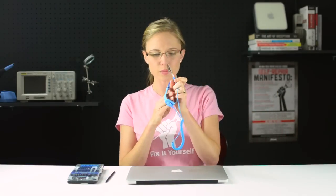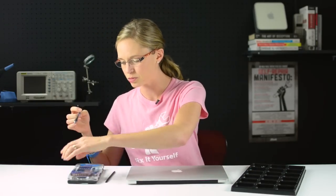I'm also going to use an anti-static wrist strap to protect my MacBook Air from any accidental electrostatic discharge during my repair, and a screw tray, because it keeps all those teeny tiny screws nice and organized. Now that I've got all of my parts and tools together, I can get started by taking out the 10 Pentalobe screws that are holding the bottom case in place.